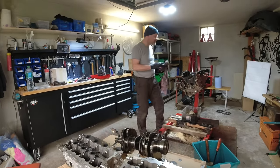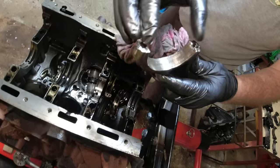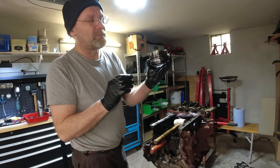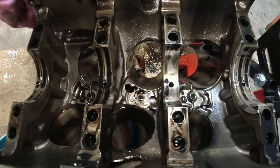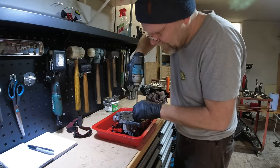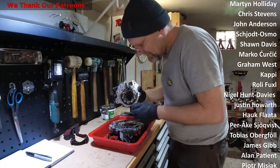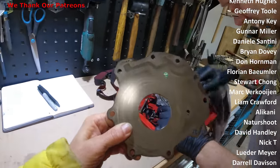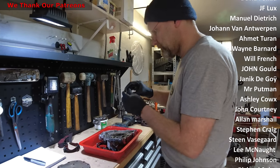None of the main bearings spun - this main did not spin, this one did not spin, this one did not spin, and this one didn't spin either. The only damage we see is on the inner connecting rod - mainly this one, which busted because it heated up so much that it seized and then basically chopped apart. We also don't see any damage on the top side of the pistons - they're absolutely clean. The connecting rod pin just snapped apart at the moment it seized.